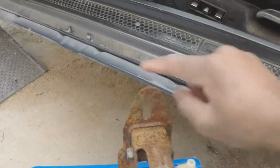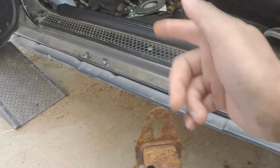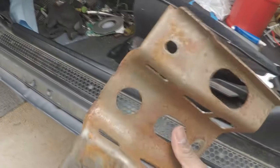there's a bracket that goes underneath that's basically a recreation of this, but it's reinforced because it's an L-shaped bracket with the triangle. The little triangle piece is going to hit on the back of this piece, so you're not going to be able to run that with this in there. So either you have an option to notch it, which I don't recommend, because you basically jeopardize the structural integrity of that top bracket, or you take this out.